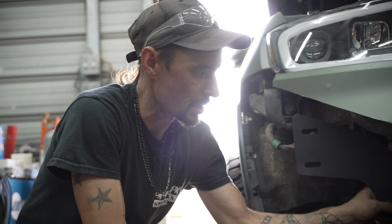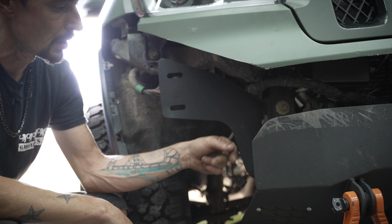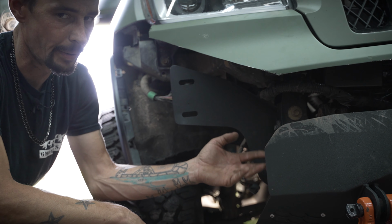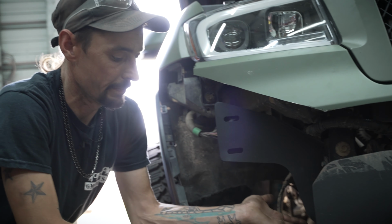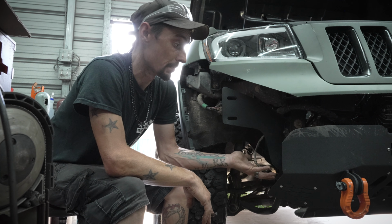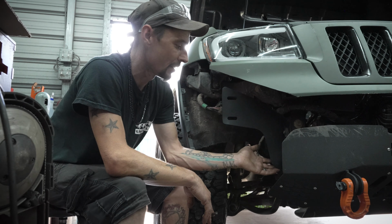Applied these outer wings. Very easy, just remove the two bolts, you're gonna reuse them. They're right on the radiator subframe. They're usually pretty tight to get in and out, they have Loctite on them. Impact works good, if an impact won't get it, do it by hand. They're a mile long, so just stay on them, they'll come out.